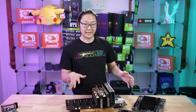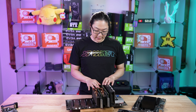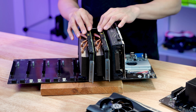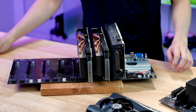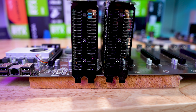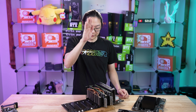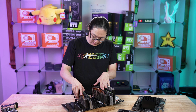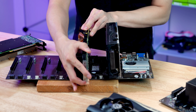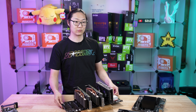It's been about three months since we made that initial recording, and I've had this running faithfully. I want to give you my review of the BTC37 board. Right now I've got three two-slot cards in this thing. Unfortunately, when they're that close together with the shrouds, you've got maybe 10 millimeters — about three-eighths of an inch — between cards. If you had fans blowing across this, it definitely wouldn't be enough space. You'd probably want to put them every other slot, which reduces the total number of cards you can fit.